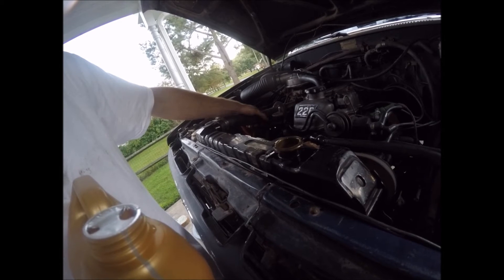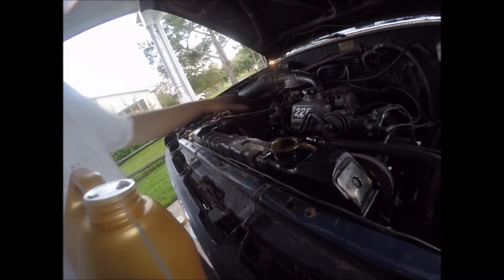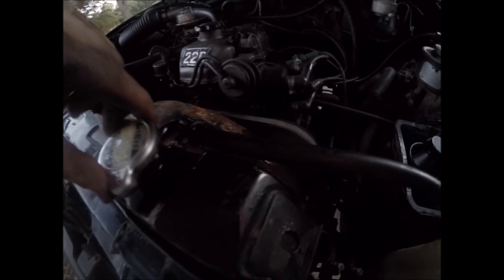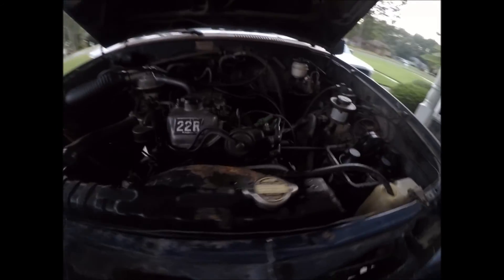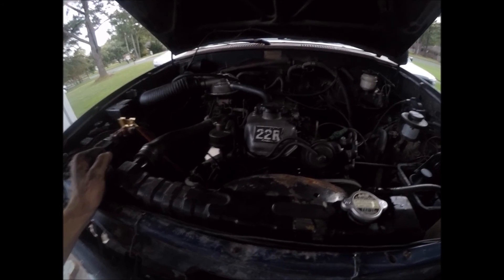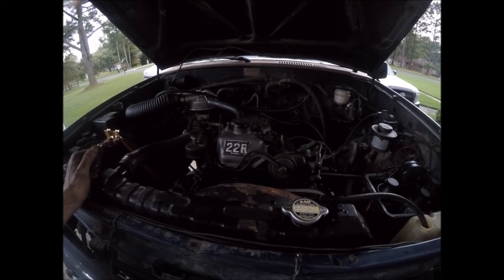None of that looks like air — I think that's just the radiator bouncing. I think we're done. That's all done, it's full. Got the V6 radiator in, burped, full of fluid, got the drilled out thermostat, flex fan — this thing should have a hard time overheating now. Pretty stoked about this. I will link the other videos in the description for anyone who wants to see them. Thanks for watching.